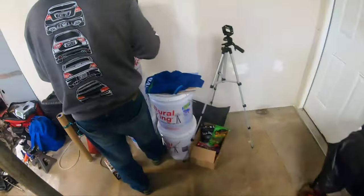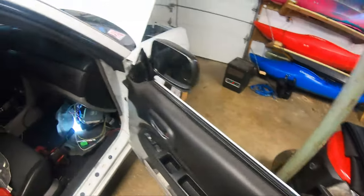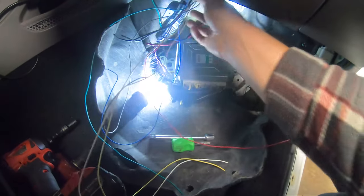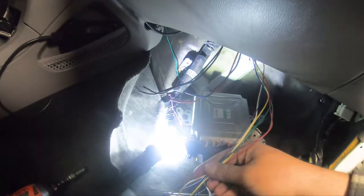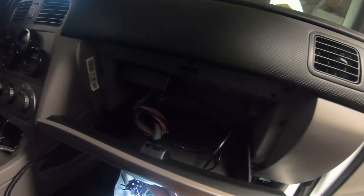Right now we're wiring down the kit. If you're going to do this on your car, you only need about six or seven wires: green, white, blue, red, yellow, and one with a tracer. The four big wires off the Maximizer controller go to the engine bay. The rest of the wires are for inputs, outputs, and timing retards for MSD boxes — you can just hide those in your glove box.